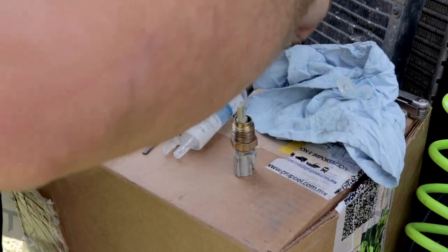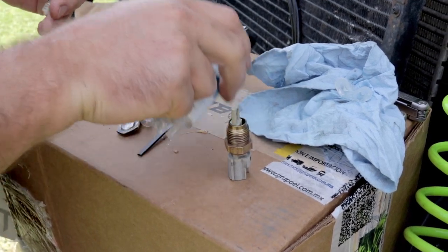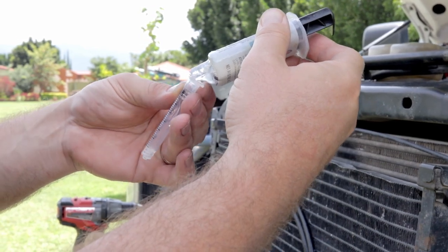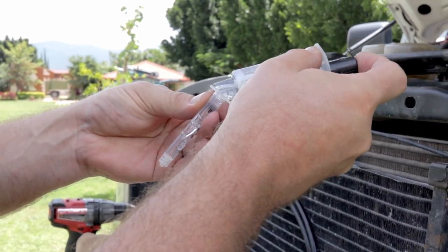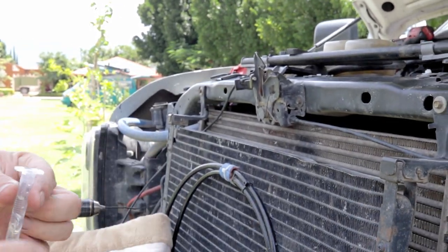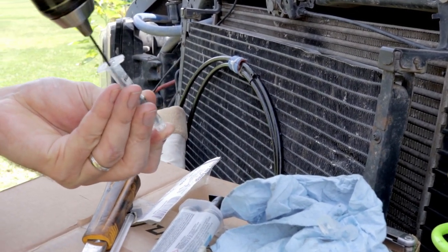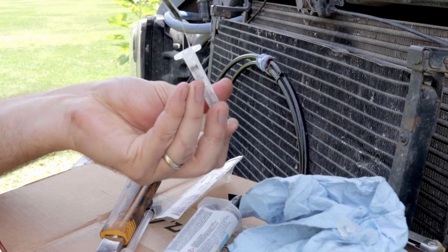All right, pro tip for delicate application of epoxy is carry around some cheap little syringes. I always cut the two halves of the plungers apart because I seem to never get them in equal amounts. Put that part A in, and then the same amount of part B. Perfect. And here's the pro tip part. Get yourself just a tail of a zip tie, the tail end of a zip tie. Chuck it up in a drill. That'll be good and mixed. Wipe it off best you can.